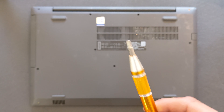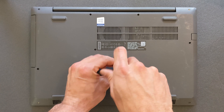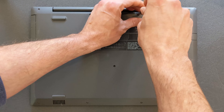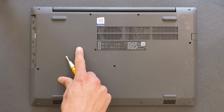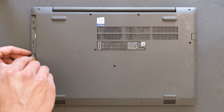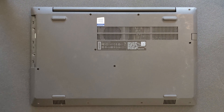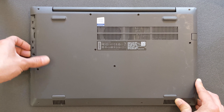From here, all you have to do is remove all the screws on the back panel — it's not going to take you more than three or four minutes. I'm going to speed things up just a bit. Once you have the screws removed, you can remove the DVD drive, and there are also two little screws under that which you'll need to remove as well. Once they are removed, you can remove the back panel itself — it comes off easy enough.